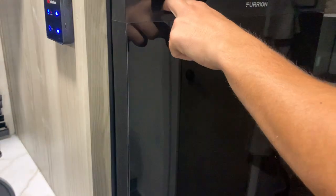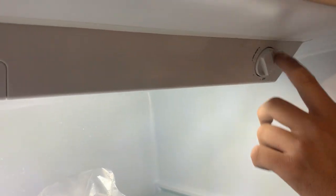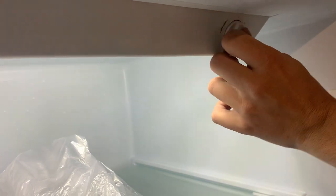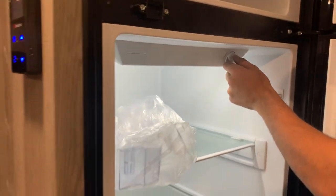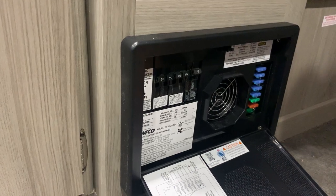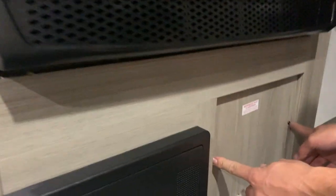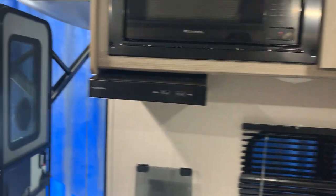Come into your refrigerator — opening this up you've got your freezer and your fridge. Right up here you've got your settings; with it all the way to the right it's going to be at its coldest setting. If you do want to run it while you're traveling, you have to make sure you have it over in the off-grid section, otherwise it's not going to work — when plugged into 12 volt it's just going to stay off, so be mindful of that. All the way to the left to turn it right off. Right down below that you've got your main circuit breaker fuse panel — whenever a breaker trips it's going to sit in the middle, so you just have to turn it off and then back on to reset it. Whenever you have a fuse blow, there'll be a little red indicator light letting you know which one's blown. Next to it, if you pull these two screws out, it's just going to give you access to that water pump for winterization. That's going to be it for this unit — if you have any other questions, feel free to give us a call.